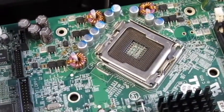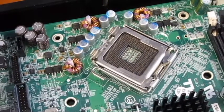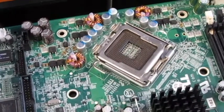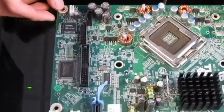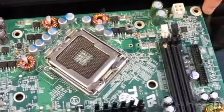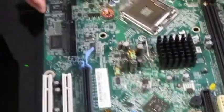This here is where you place the CPU. To make sure your CPU is compatible with the motherboard, go check the motherboard manufacturer's website. There are six screws that hold the motherboard in place. Now I'm going to put the motherboard and screw it into the computer case. But before you put the motherboard in, make sure you're grounded — use an anti-static wristband.